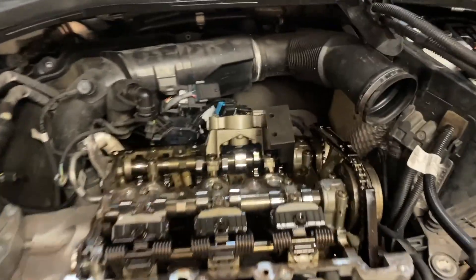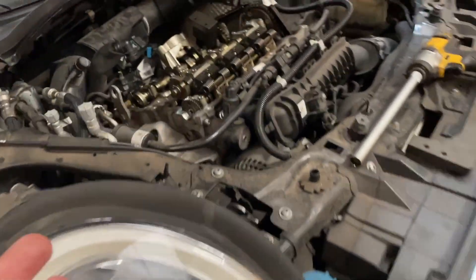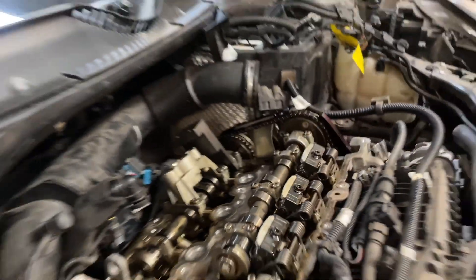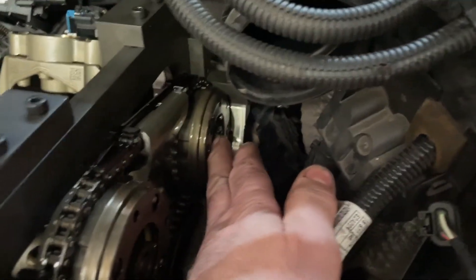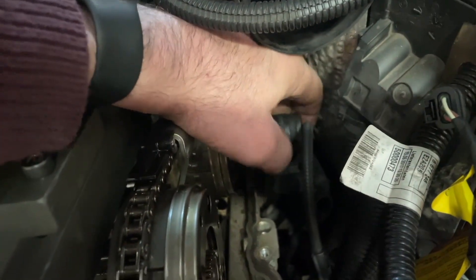This is our locking tool. I need to rotate the engine to have this vertical in the right position. It's a manual, so a little trick: I can either take the road wheel off and turn the engine by hand — I've taken the plugs out so it should rotate easily — but what I've actually done is lowered the car onto some wooden blocks, put it in third, and now I'm going to rotate the road wheel to move the engine very easily. It's a lot less hassle than taking the wheel off. So that's our locking tool on. What I'm now going to do without taking the tensioner out is crack that nut, leaving it all on. This is a bit of a workaround because I don't need to take the sprocket off — I just want to take the Vanos out. I've cracked off the Vanos with a bar and now I'm just unscrewing it to see what condition it's in.